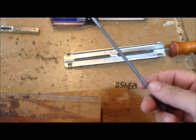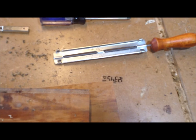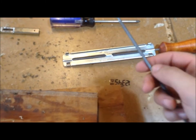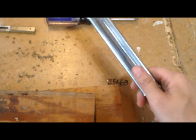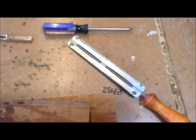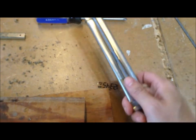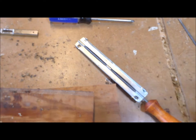I've been talking about my problem with the hardware in here pretty much since the beginning, and lately my blades just will not hold an edge. I should have picked up on this earlier, but I replaced my 5/32nds file with a new one — I hand-file these — and it's really cutting into the chain quite well now. I don't think the chain is super dull, but it's dull enough that a new file works much better on a chain that's been hit with hardware. By changing this out I'm making much faster progress.